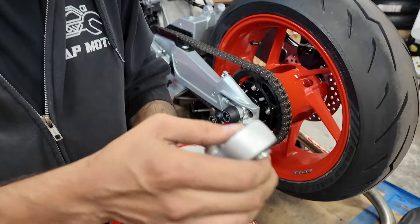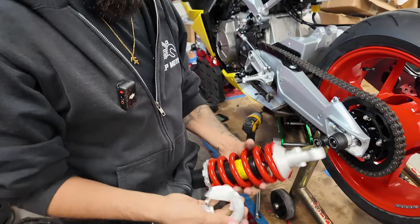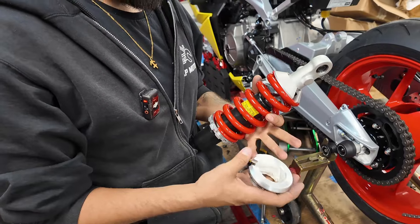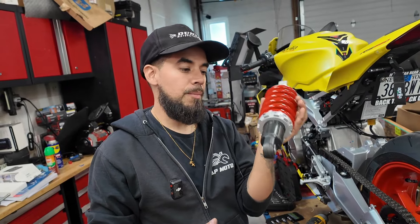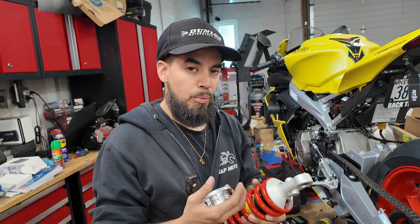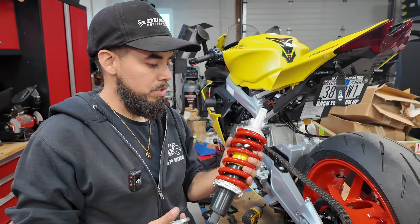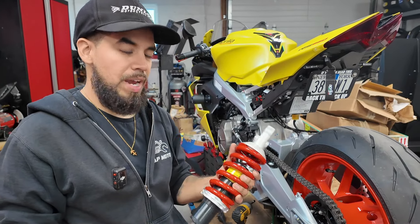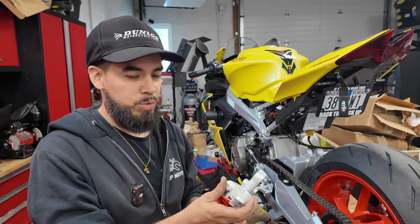Here's the top part of the kit — be very careful not to lose the little spacers and washers because they provide some dampening. Note that the Aprilia RS660 up until 2023 had a different shock. For the 2024 they changed it, so any lowering kits currently on the market — there's one called Truest — may not fit. Be very careful about what you order; make sure you get it for the specific year. For 2024 you'll need to get the top portion swapped out.